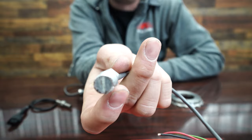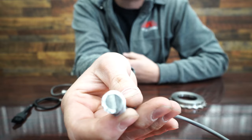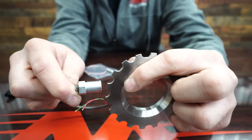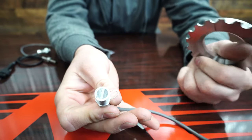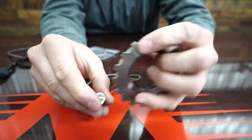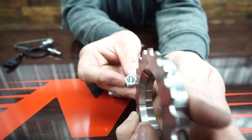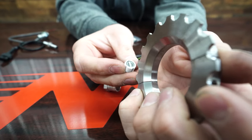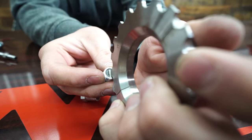That's how they pick up the signal, and if you look at the size of the sensor versus the strip, that can be a little misleading. If you think this thing is square in the middle it should be good to go, but if you really consider how small that strip is, there's a lot of room for error. You might only be catching the edge of that strip on this huge sensor — you think you have a huge buffer but you're going to get noise, and it almost looks like it's centered.